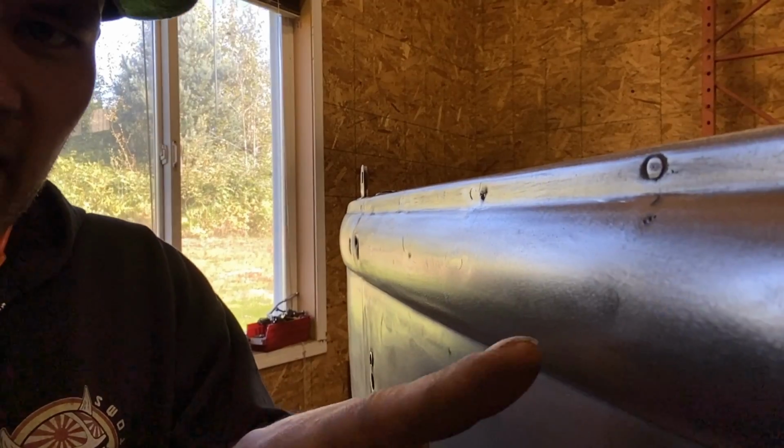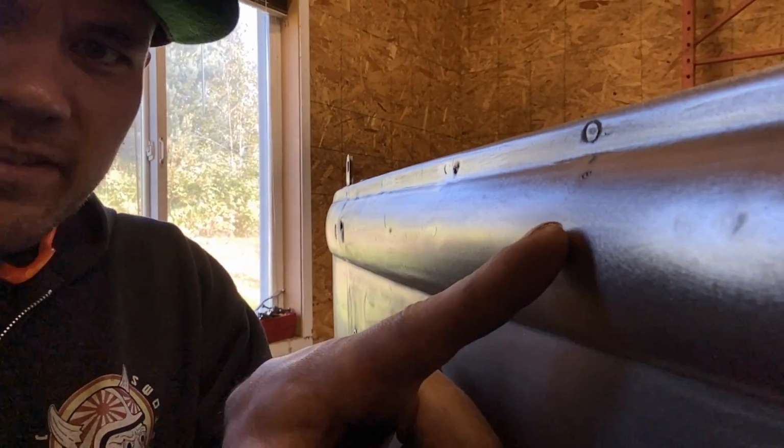There is the tiniest bit. You can see like these are a tiny bit low. That's just the truth. Everything gets filler. There's no metal finished cars that just go straight to paint like that. They don't, I promise you. There are cars that are extremely well done, way further along than this, that are next to perfect. And those cars still get filler, whether it might just be a polyester coat, like a sandable primer that does fill a little bit, or if it does get a little bit of Bondo, but that's just the truth.